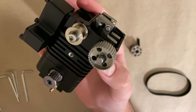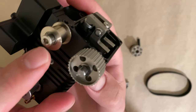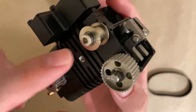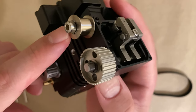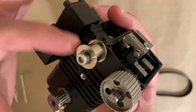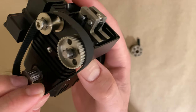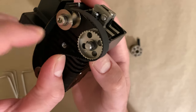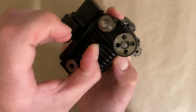When installing the idler pulley, which is this piece, you have to make sure this part with the little ring around it is facing out. I made sure that I did that and you could see the pulley is doing its job by spinning. So your timing belt would go like this and then you would have your fan pulley over here, kind of like this.